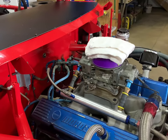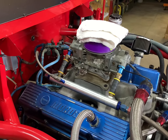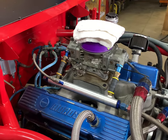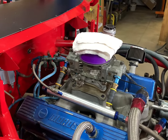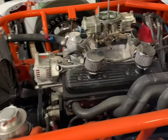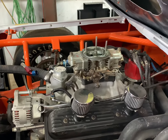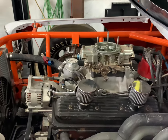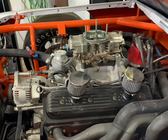As I was saying in the intro, this is a 390 cfm carburetor — this is a spec carburetor that you have to run in the current super late model series, at most super late model tracks all around the country and most of the touring series. The problem is it's a 390 cfm and this is a big old hoss motor. Over on the Nova we just put a little 602 crate motor in it, but we put a big 750 on it. So we're going to swap these out — there's no need having the big carburetor on a small motor, so the 390 will be perfect for the 602.